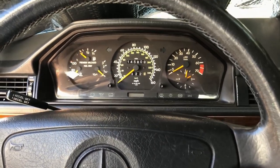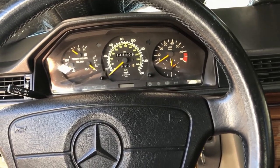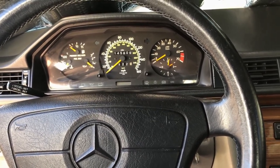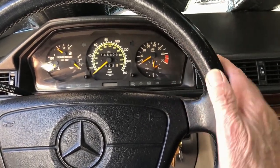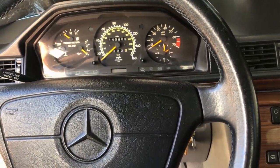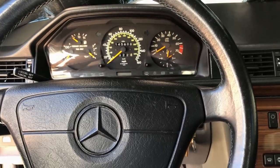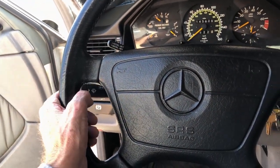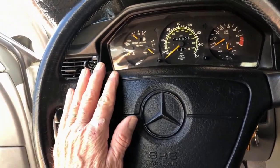It's October 22nd or 23rd, 1992, W124 300E. I've been having a problem with the fog lights, one of them is on and off sometimes. And the high beams, one of them is on and off sometimes. The last video, it all worked except for the flasher part of the high beams. So today I'm going to replace this combination switch